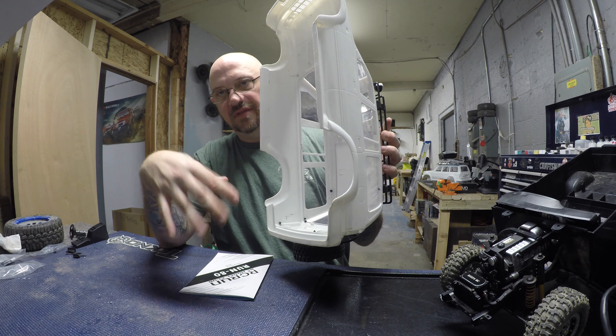There's a little piece they don't show you assembling onto the axle — it doesn't come pre-assembled. That's the piece that goes to your rear stabilizer bar. The last page basically says, oh yeah, put that motor in there. I don't think you can fit a 550 can — I think you're stuck with a 540 size motor. I used the Fusion Hobbywing 2300kV. It is 48-pitch pinion and spur, and most gears in the transmission are 48-pitch, so you can go with a smaller pinion if you're getting heat from running the truck.